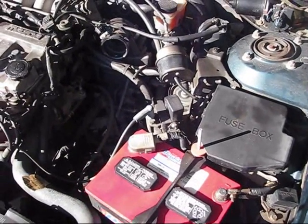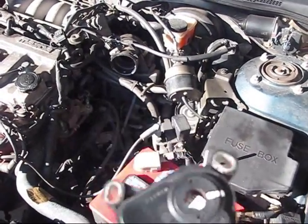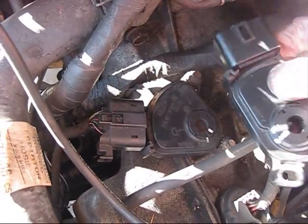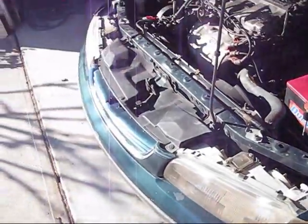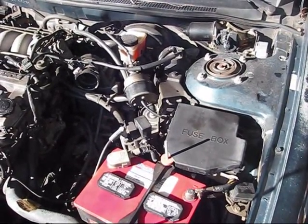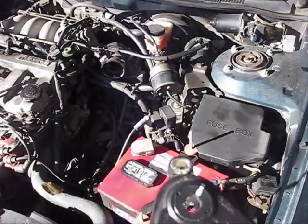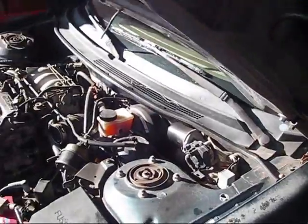After the transmission speed sensor was replaced, this didn't help that much. The vehicle still does the same. This Mazda 626 engages gears only for 40 seconds. After 40 seconds it doesn't want to engage drive, reverse, neither the first nor the second gear. When you switch the engine off for, let's say, 2 minutes, it's engaging the gears again